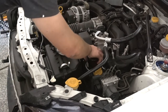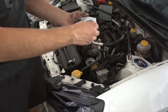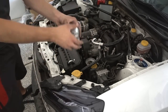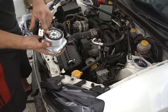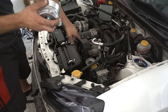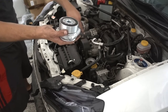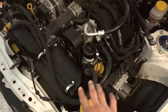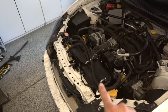We're going to start by removing the oil filter. Some people might need a special tool, but from my experience if you just give it a hard twist it'll pop right off. To install the sandwich plate, take the actual sandwich plate — this long tube needs to go through both the sandwich plate and the spacer, and it goes on top like this. The part with the fittings goes on top and the bottom part with the rubber section touches the surface, creating a seal. The rubber part beneath the sandwich plate goes on top of this, creating a seal there, and the other creates a seal on the bottom. Then you just screw it in.